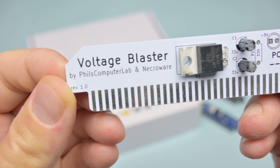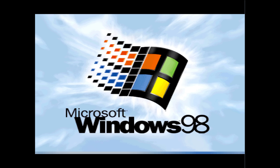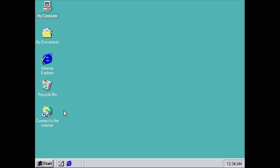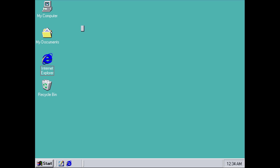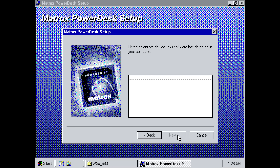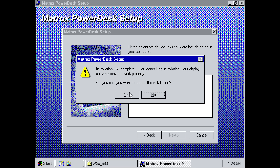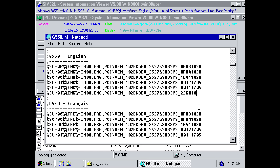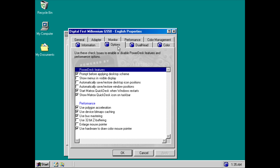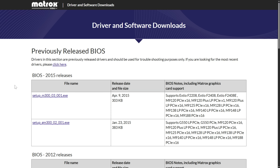Using the Windows 98 quick install we are up and running in no time. Now it's time to check out the drivers. Going straight to the latest driver version, the video card is not being detected by the driver — but that's not a big deal. I'm patching the INF file; you can use a diagnostic tool to get the PCI device ID, and off we go. Driver is installed, we are up and running.